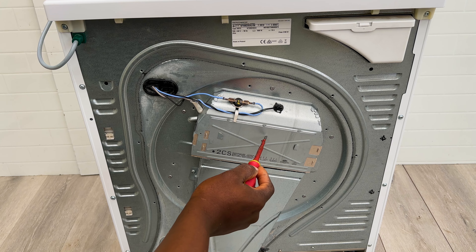You're going to make sure it's got to beep if it's working. So you see this one's not beeping, which means that it's faulty. It means that this fuse has not reset because this thing is cold now and it should have reset by now.